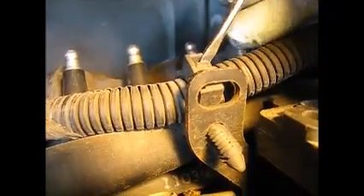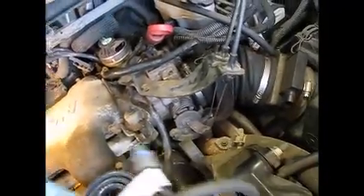It looks like we're coming along. We've come to a little cable router here, and from there it looks like there's just two or three more. Here's an easy one — the alternator control wire. I'll call that number eight. Now there's one down here to the left side of the coil assembly — fairly easy one. That one's number nine. All that remains is this one. At one time it had a panel fastener type connector — probably somebody took this apart before. It actually belongs underneath the coil. We'll get this apart — that'll be our tenth one. Let's take the connector and harness and get it out of the way.